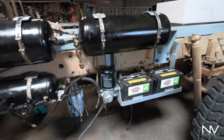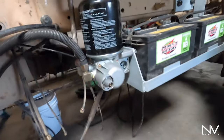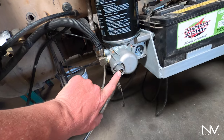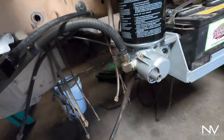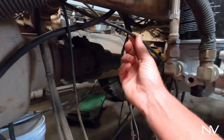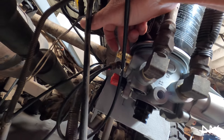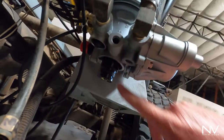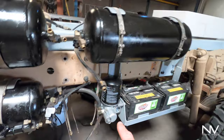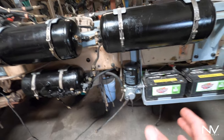So just that one bushing and you're all set — everything else unscrews and screws right back in. Here's the air dryer, I'll link to it in the description. It's got an in and an out. I mounted it right here — it has its own regulator so you can set the pressure up to 145 if you want, but I've got it dialed into 120. This here is the governor line that comes back to this port. It's quarter NPT on the housing, there's a little bushing, and the piece here is what came out of the original dryer. The purge valve is on the bottom — it has a 12 volt heater but I'm not anywhere cold.